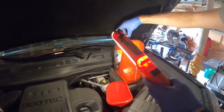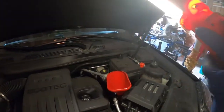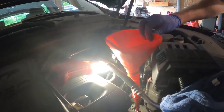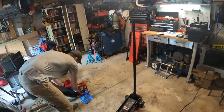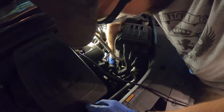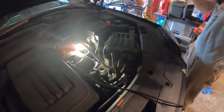Three quarters — put your lid back on so you don't make a giant mess. Now what we're going to do is let that drain out. I'm going to stick this back and as I lift the funnel out I'll try to get a rag on it — pull it out. Put that plug back in, set this down. Why are you putting the lid back on? Well, we also have to run it for about five minutes and I don't want junk falling down in there.